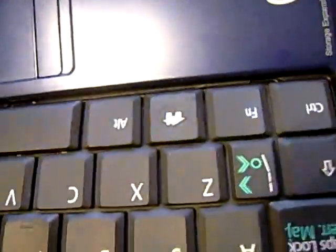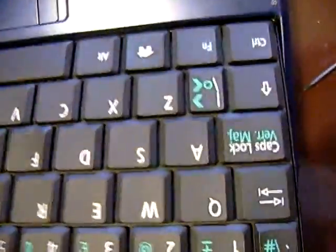Make sure the trackpad connector is fully inserted — there's a black line and it matches up with the white on the motherboard. Here's a close-up of the keyboard connector. Same thing — make sure it's fully inserted. Then fold the keyboard down and make sure it sits in there properly. This is a lot easier than taking it out.